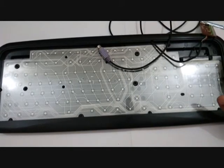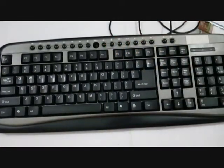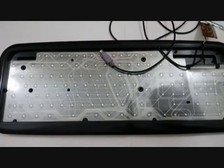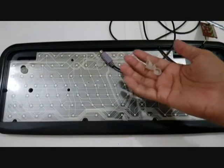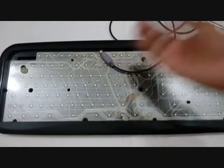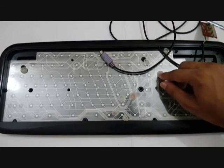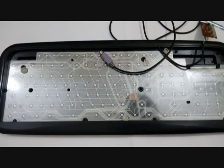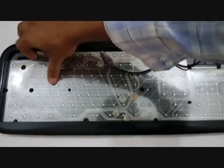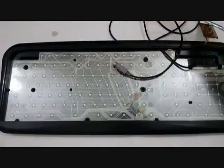Your warranty is going to be over and you can spoil the keyboard. As you have seen, it is a very complicated affair. When you remove the keyboard cover and the keys, beneath that you have these very small and tiny rubber pieces. When you remove them they can easily be lost, and for that particular key without a rubber, the key won't work. You can also really spoil the keyboard if these plastic sheets get torn.